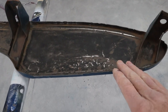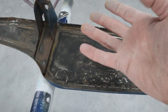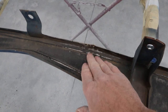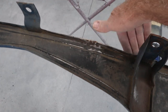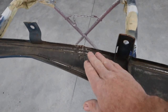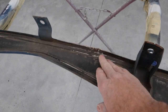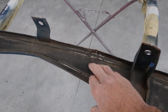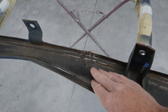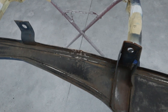We've got it upside down and you can see hammer marks right here, but on the other side it's perfectly smooth — there's some body filler on the other side. This has been obviously straightened before. Right where we have that big kink and big bend, there's hammer marks here, and on the other side, even with it bent, it's nice and smooth. So we're going to have to be a little careful. I'm going to do a lot of pushing and not hammering because if it's been bent back and forth before, it's probably getting work hardened right there and I don't want to crack it.